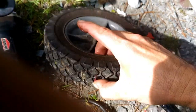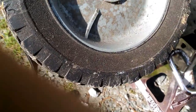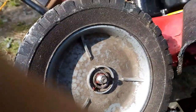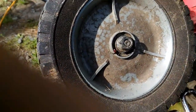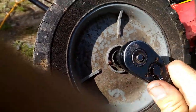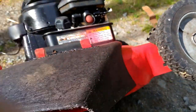Keep those axles clean so you don't get that grease build-up, and that keeps these wheels from wearing out. I tend to do this sometimes when I'm servicing push mowers, if they're really bad. It just makes that push mower last a little longer and makes for happy customers. Bang-o. There's very little wobble — see, this one has almost no wobble. And that's one of my favorite tricks on push mowers.